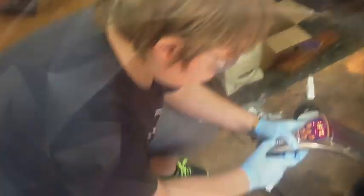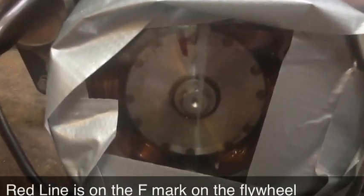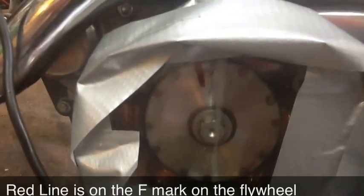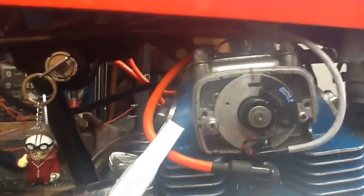So we're idling at about 1,300 RPM right now. With our makeshift shield, we put a red mark on the flywheel, and we proved that to be true. So now we're dialed in — we are top dead center, everything's lining up.